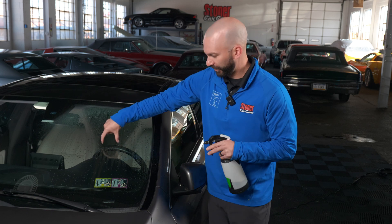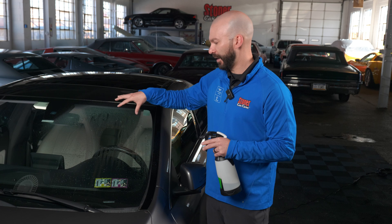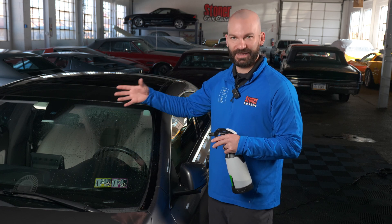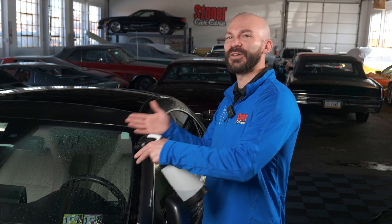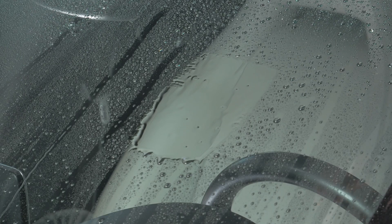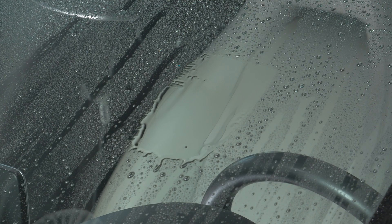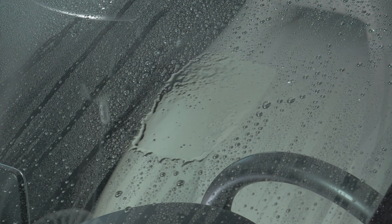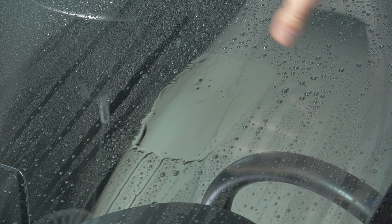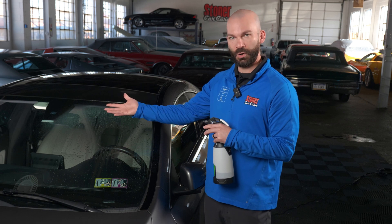In the middle section here, we used a glass stripper to remove all the coatings, and what you're left with is the raw OEM glass, which naturally is a bit hydrophilic. What's happening there is the bonds would rather go to the higher energy surface, so the water wets out — and you could call this a form of sheeting. A little bit of water will flatten out a long way and has no problem just sitting on that surface.